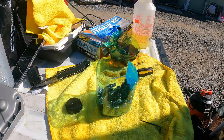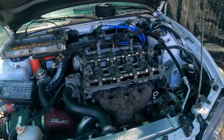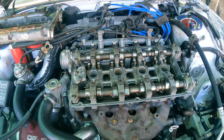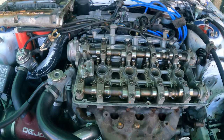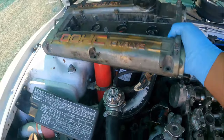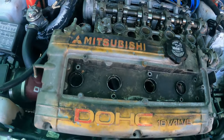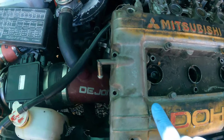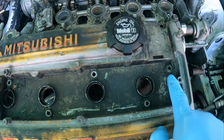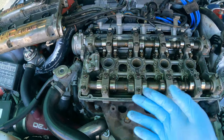To install these lifters you are going to have to redo your timing — at least I would, just to make sure everything is done right. I already removed everything. The reason I'm replacing them is because I'm doing all my timing side right now, so this is the best opportunity. I already removed my valve cover — on the valve cover you have 14 screws. You have three in the bottom and three in the top. That's six total on those sides, then the rest make fourteen. You remove all 14 screws, wiggle it a little bit, and remove the valve cover.